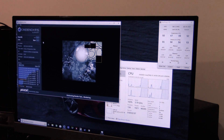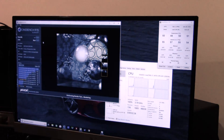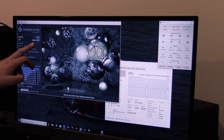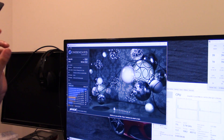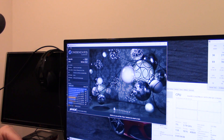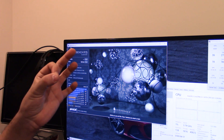According to Realtemp, we are locked in at 3.811 gigahertz. The score is 526 on the Cinebench. So going from just 3.2 to 3.8 gigahertz using just the multiplier on this motherboard — again, your motherboard may not allow it — enabled us to get a 57-point increase, which is dang near a 15% increase just for monkeying with the multiplier.